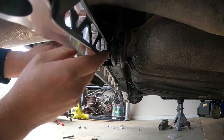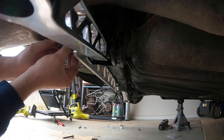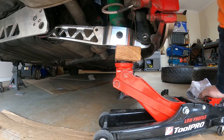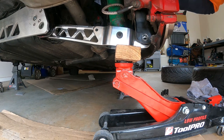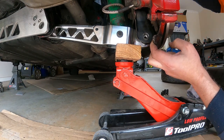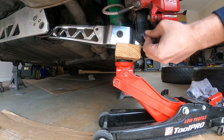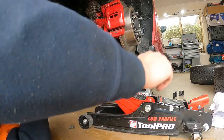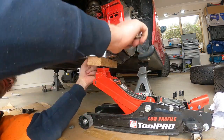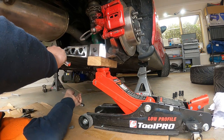When doing up the lower control arm, you'll have to use the factory bolt. To get the bolt in where it attaches to the knuckle, you're going to have to jack up the lower control arm just to slip that bolt in. It's also a good idea, while the suspension arm is still jacked up, to torque the bolts up to spec so that everything's tight at the angle the suspension will actually be traveling when it's under load.